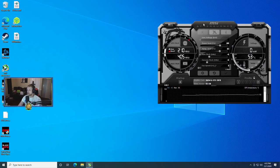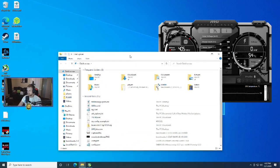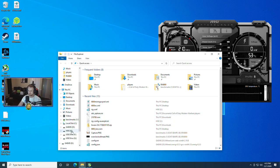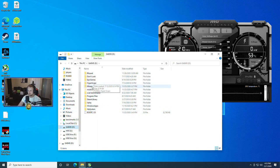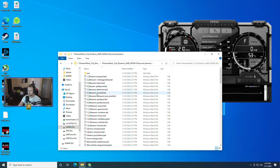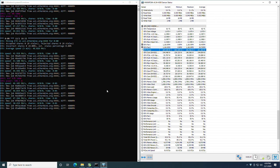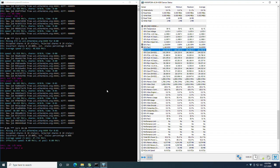Alright, let's get into the numbers. I have MSI Afterburner up to show pre-overclock and post-overclock results. We're using the latest Phoenix Miner 5.2d and mining to Ethermine. Right out of the box at stock, you're looking at around 50 megahash per second at 203 watts — not very good.